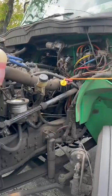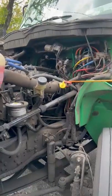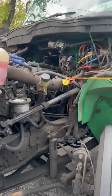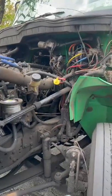My transmission dipstick has not been broken or cracked, it's secure. The way I would check it is with the engine on — I would pull it out, clean it, reinsert it, take it back out, and make sure it's at the proper fill mark. If it's not, I would refill it myself.